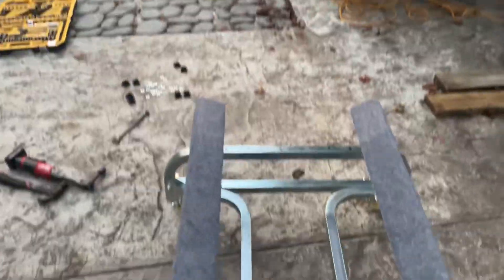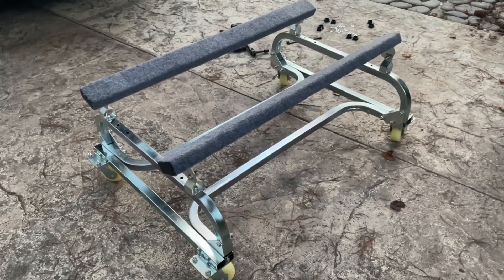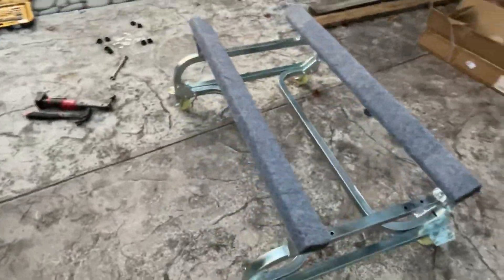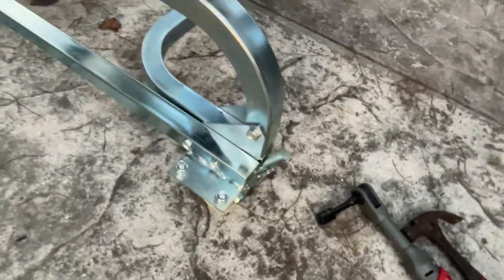This will be perfect for taking my skis off the trailer so I can roll them into the garage and detail them. My trailer actually needs a new set of springs, so rather than doing it at the boat ramp, I'll do one side at a time — it's easier to get in there without the ski on. Word of caution for anyone putting this kit together: there are no extra lock washers or extra bolts. I have some extra washers here because I think they wanted you to put a washer on the outside of these bolts as well as the nuts, and I didn't do that — at this point that ship has sailed.